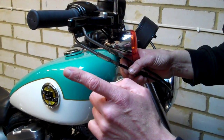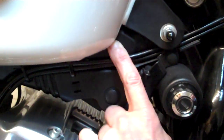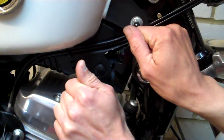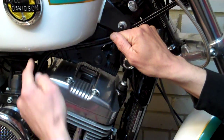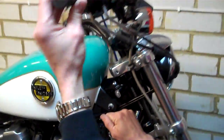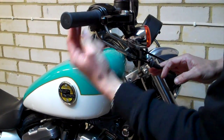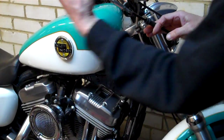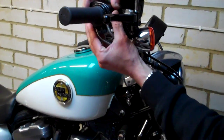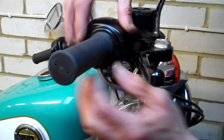Just a quick one for you — the easiest way to diagnose: I think you've trapped a cable, mate. When we follow the cables down on your bike, they go up under the tank, so you've got to lift it up and make sure you haven't trapped the cable, because if you put too much of a bend in the outer that's going to cause it to jam. Take off the return cable — actually take the barrel off the end, remove it from the throttle — and see if it springs back. If you remove the return cable at the bottom end and it starts springing back perfectly, you know the jammed cable is causing the problem. If you remove it and it's still jamming open, then you've probably got a problem in the throttle housing. Get your Torx heads, loosen off the housing, take it apart, and if it then springs back you know it's jamming up in there.